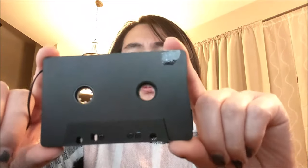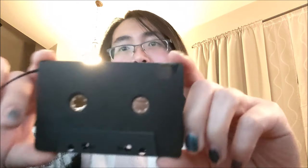So, you know, this one is at your own risk. Not only that, but you will have to tape this up to give yourself a nice flat surface for those cassette decks that detect the holes up there. Whereas this one by factory, it's already nice and flat. So yeah, it's not any rosy conclusion, unfortunately.